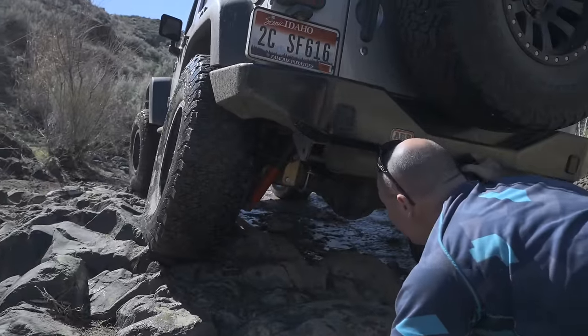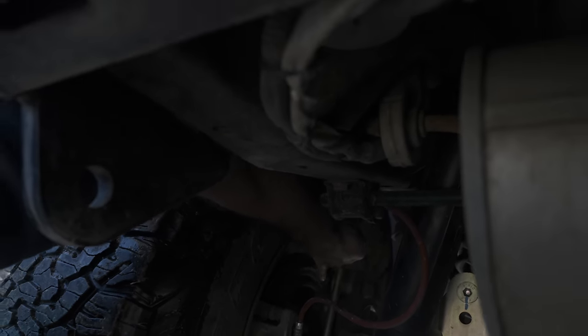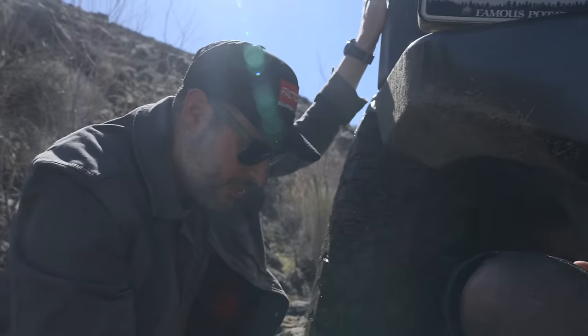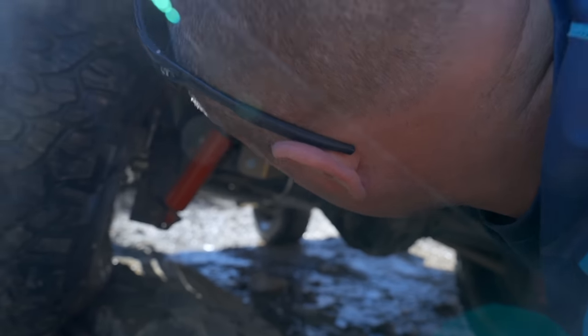Got it. I got it. It's his control arm, and there's this clip right there. That clip is popping. It doesn't look like it's sitting right. Well, good to know that it's just a piece of metal slipping around. There's a clip back there, like a sway bar connector clip, that is basically jostling around a little bit. We don't think it's going to be detrimental. It's just something that's making noise and kind of binding up.